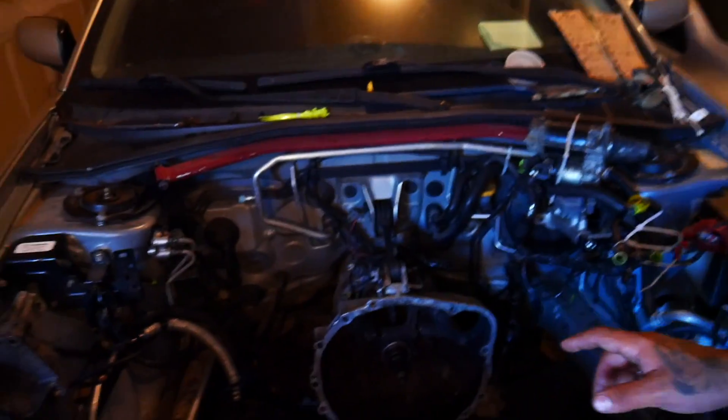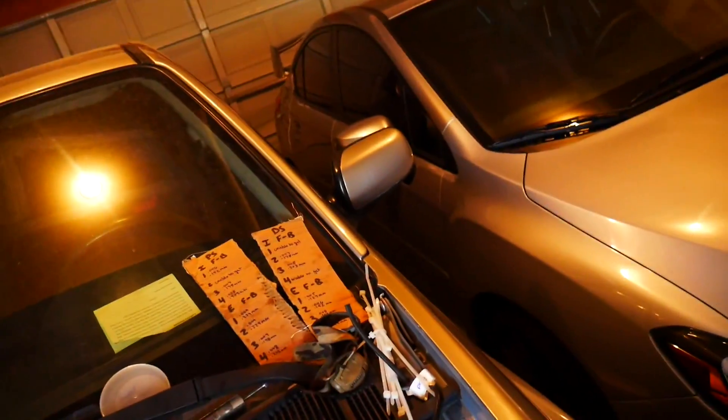Like I said, no one has this stuff labeled online, so this is a quick video that'll help you set up the PCV system and not run coolant lines to the PCV system, or run the PCV system back to itself so it's not ventilating — it's just pressurizing. You don't want any of that. I'll give you a breakdown of this stuff in a future video and also go into valve clearances. This is going to be a time attack STI build — I'll cover that with an intro video in the future. This is just for the PCV system and a little bit of the engine teardown. Thank you.